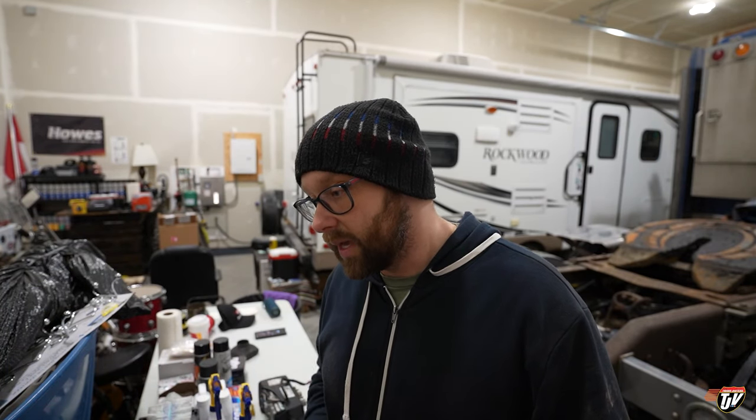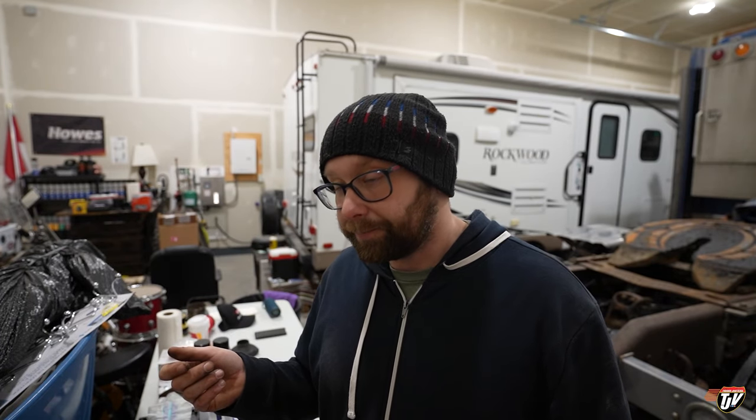And then it takes a drip of diesel fuel and it keeps your cab warm. It produces heat and blows heat into your cab. That way you can stay warm at night and you don't have to idle your whole big diesel engine at night, because that costs a lot of money and maintenance to constantly be idling your engine. You don't want to do that for long periods of time. It gums up your engine, your injectors, wears it out, and you want that engine to last long, because that's the most expensive part of this whole operation, that motor. You want to save that as much as possible. So I always say it's cheaper to buy a new starter than to rebuild your engine.